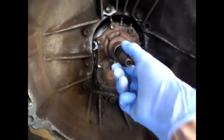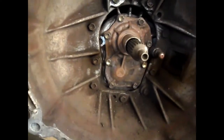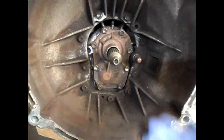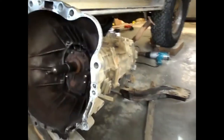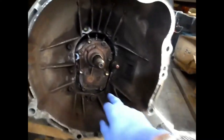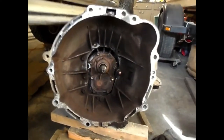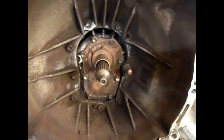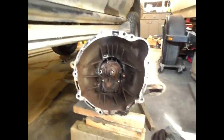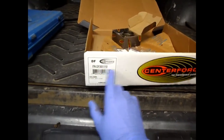What I did is change the seal at the transmission input shaft inside this housing. You have to pull out these eight bolts and the seal is located in there. Make sure you tip the transmission back the way I have it angled, otherwise your transmission fluid will run out and make a huge mess. When you reinstall the bolts, put bolt sealant on them according to the manual.